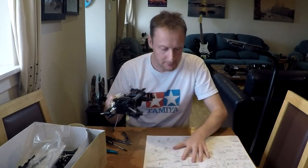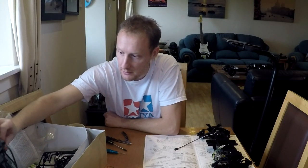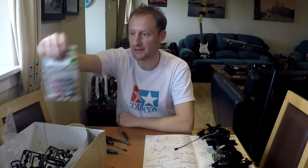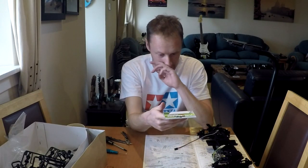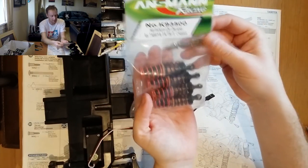Part 21 is all about the shock absorbers — or rather, they're not really dampers because they're not oil-filled. These are plastic friction shocks, but I'm not using those. Here's one of the included springs — very soft. One of the handling deficiencies of this car is down to the lack of real dampers, so I've got these Ansman Racing ones I found on eBay. Ansman doesn't exist anymore — Team C bought most of their stuff — but Ansman made good kit.